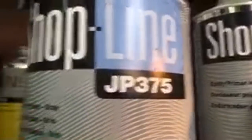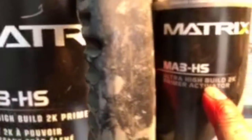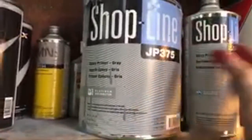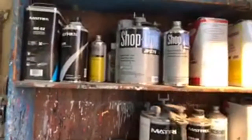See that right there? That says hardener. That is not an activator. This is primer — this is high-build 2K primer. This says activator — that is an activator for this sandable primer. A hardener hardens the epoxy primer; it stops it in its tracks and it's non-shrinkable, non-sandable. That's all I'm going to say about epoxy primer. Take it or leave it.